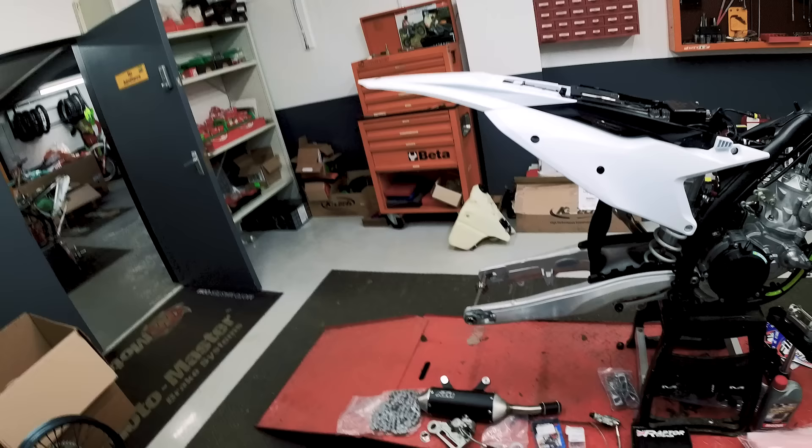Back on my old YZ years ago, when I was racing Yamaha, I used to get two silencers, chop about two inches off one and weld it onto the other. It made an ace difference for what we were doing — obviously it was a full-on motocross bike that we were using for world enduro. That just calmed it nicely for when it was real slick. Back then I couldn't really find any silencer that was better, so we just modded a standard one and it worked great.